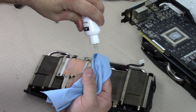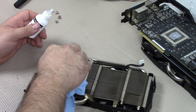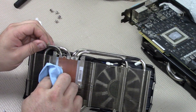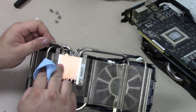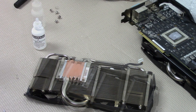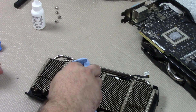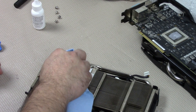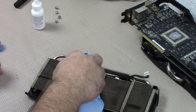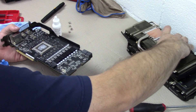After you get off the bulk, put some on your finger and go over the surface. Once you're fairly happy with the surface being clean, grab stage two — it's the surface purifier. Do the same thing, just go with the grain. For your last pass, choose a clean spot on the towel and wipe from the center out. This helps keep any debris or loose stuff from collecting. Once the heat sink is done, set it aside — it usually takes about a minute to fully dry.